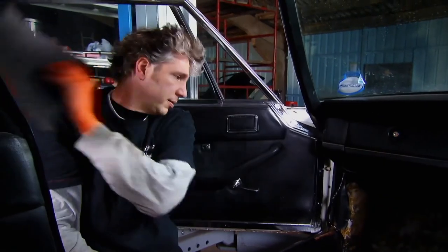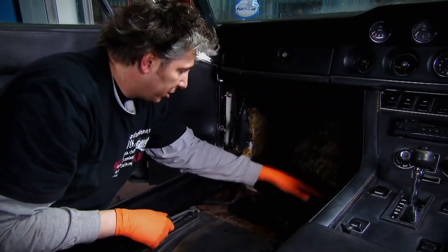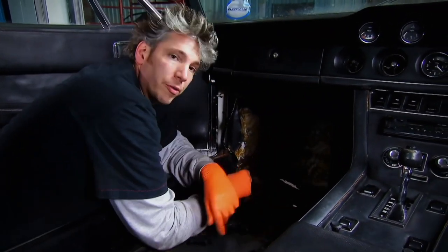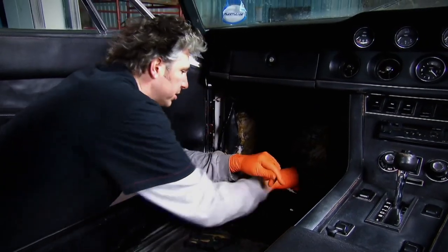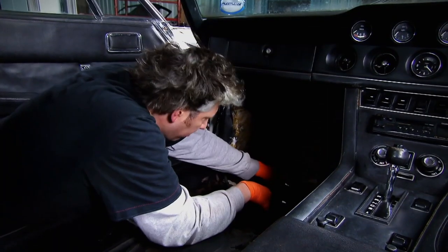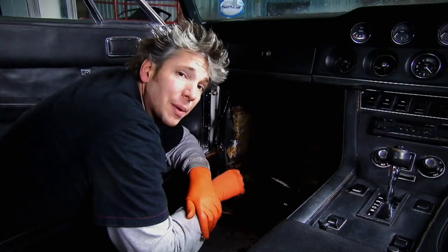Well, there's the sound deadening off. Now we can see the full extent of all the rust and corrosion and it's not looking so good, to be honest. You've got this big hole that we knew of before, another hole here — actually that's a bit worse than I thought. And then there's another big hole at the front here as well. I think what I'm going to do is just trim the edge off the top so I can see in a bit further and hopefully work out how we're going to do the patch.